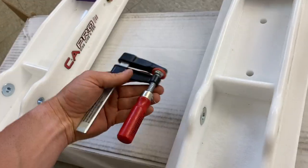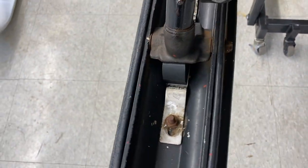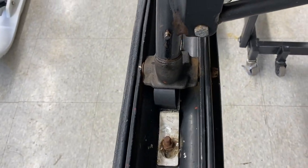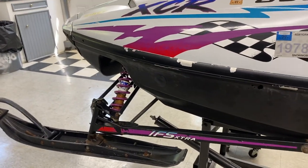So we have all bushings in — you just got to press them in, they go really easy once you get them started. As for these skis, back in the day they used to have cotter pins in the nuts. This one wouldn't come off — there was a cotter pin on one side but not the other, and they were frozen in there. I honestly don't think they've ever come out in 19 years or whatever. We'll get these off and then get the new ones on.